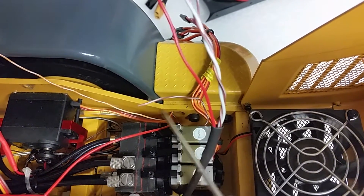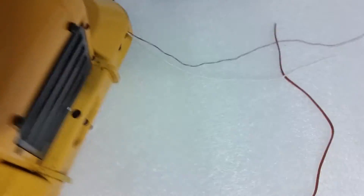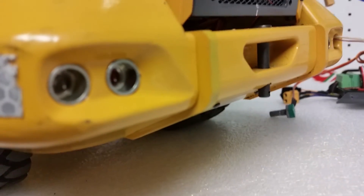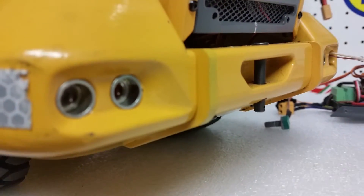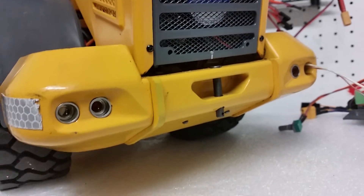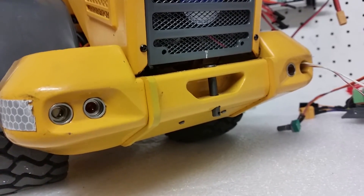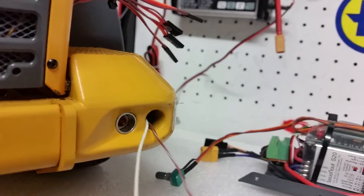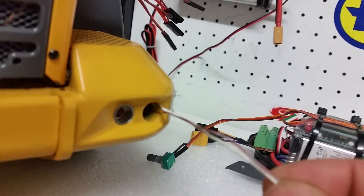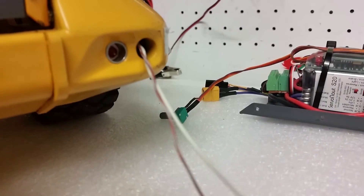Once you've fed the wire in from here, they will actually come out on this side. As you can see, the inserts are fitted in — the inner light is the red brake light and the outer light is the reverse light. When you feed the wire, you will get a wire in and a wire coming out. We have soldered two wires together so that we can pull them back in, and at the end of those wires we're going to solder our LEDs.